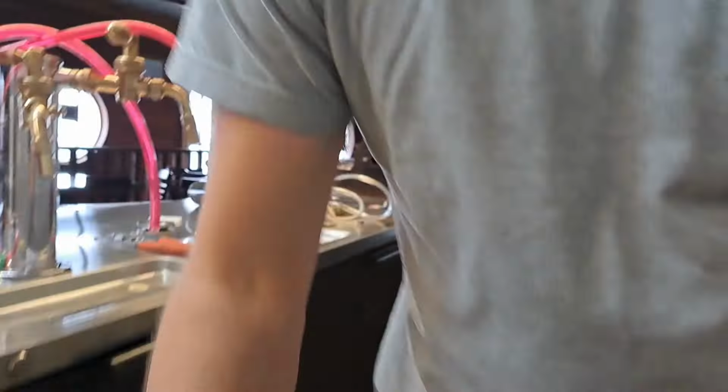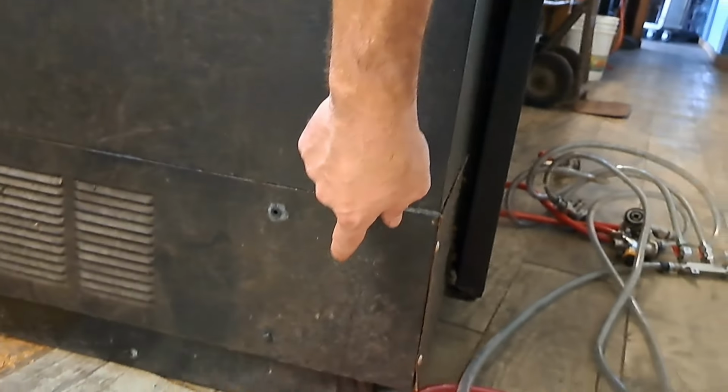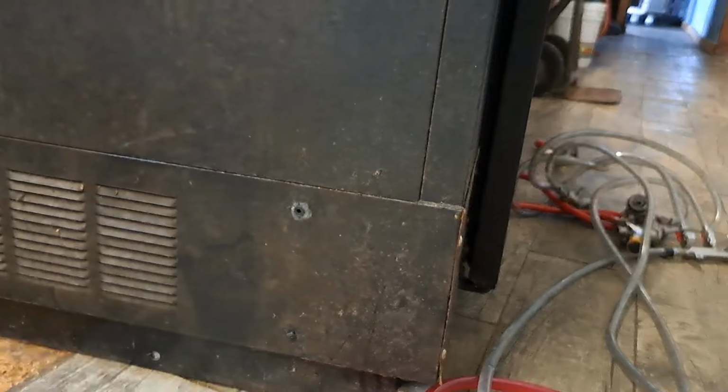and found that there was some debris in there, but more importantly, a piece of metal had fallen when I stupidly unscrewed these screws over here to try to access the whole unit, and it dropped a metal bracket down, and it blocked the fan from spinning. So the fan was stuck, and the compressor was super hot because it was compressing the refrigerant, and the refrigerant was not transferring its heat energy away, so it just got hotter and hotter and hotter.